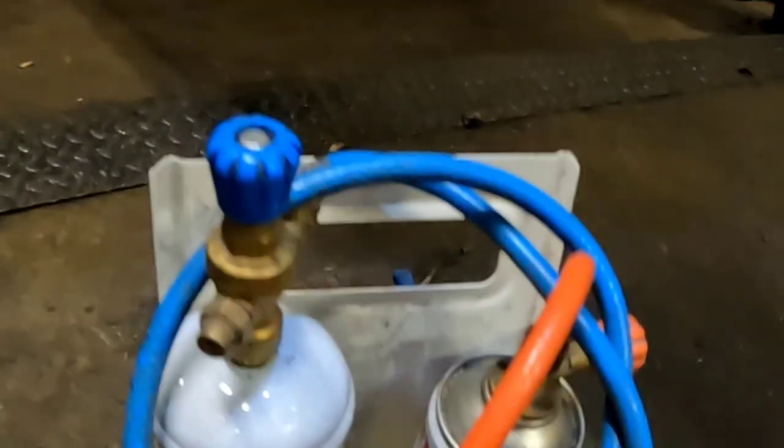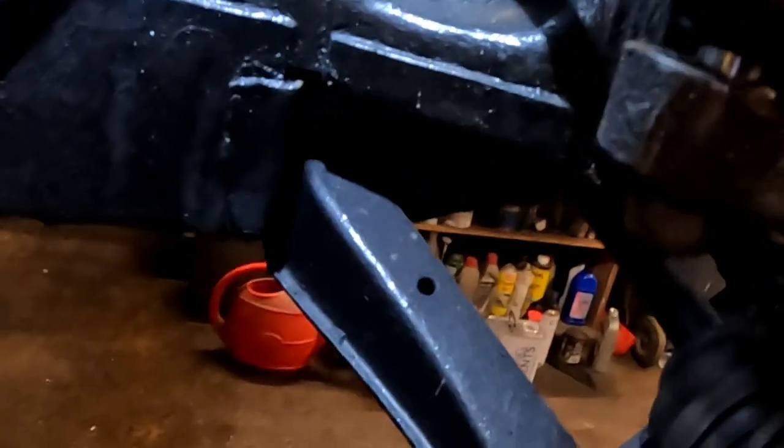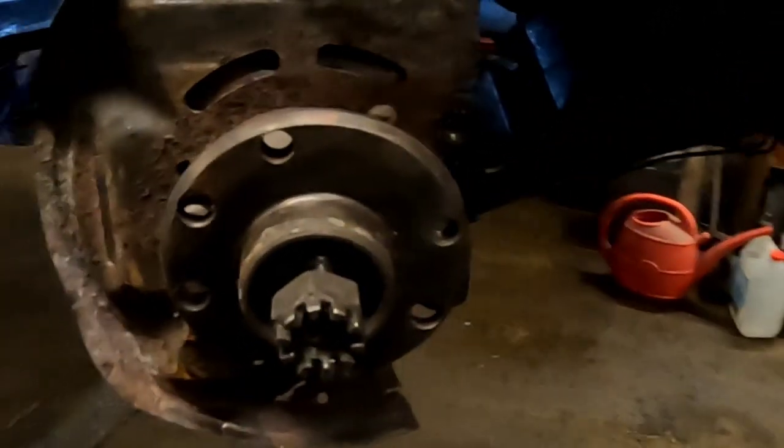I know that they're not like full-on oxyacetylene bottles, but these little gadgets, mobile Castolin bottles that I got from eBay, are fantastic. Just enough to get stuff like that. A couple of bangs on that, and it came loose. It wouldn't come off until we put the heat in it, and it came off no problem at all. So just got to take these two bolts off here, and then I've got the hub assembly, the carrier, and I'll go and fire the wheel bearing out of it using the press.